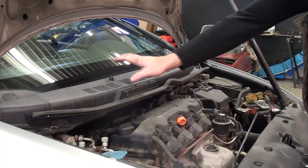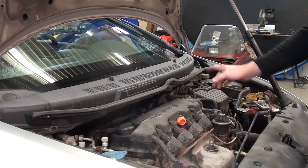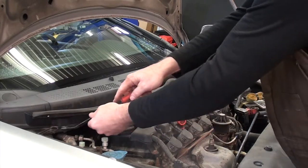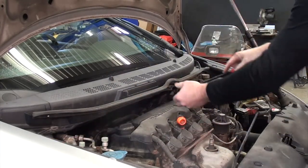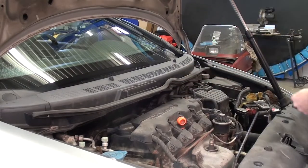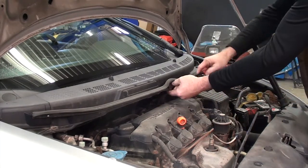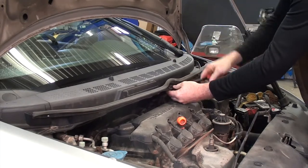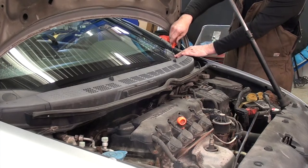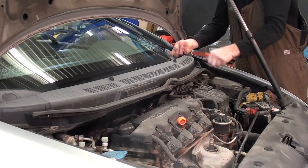With the wipers in the service position, we're able to remove this cowl and take off the inspection tray, or whatever you want to call the undershield here, to gain access to the clutch master, which is located way down behind the left front strut tower. Got some Christmas tree clips here we can remove. One. That one's being challenging. I like to remove the caps for the strut tower access, to remove the struts. I put my hand in behind it and I kind of help it up.